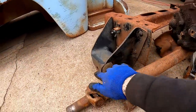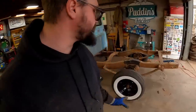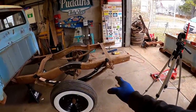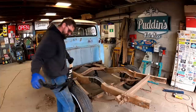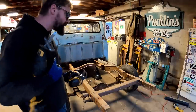You see how on these C10 hangers you've got a tab on each side? International basically just has a stud hanging out there — same thing up top. I'm not saying that would ever be an issue, I just don't like it. I think our C10 leaf springs are pretty close to the same length as these — probably bolt in. The C10 one's slightly longer, but nothing that shackle wouldn't make up. We ain't going to have quite enough time to get our rivets off, but we'll at least sawzall these bolts and slide the rear end out.